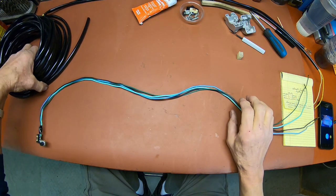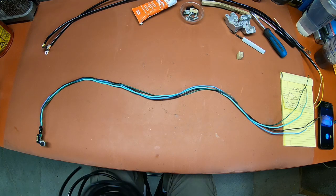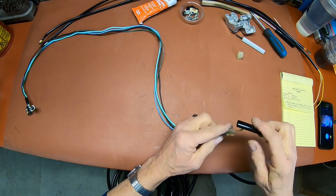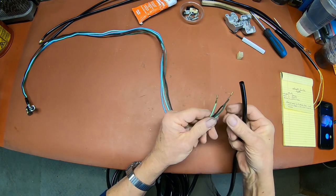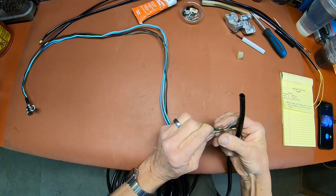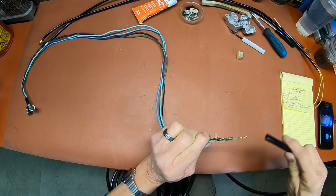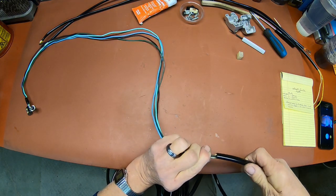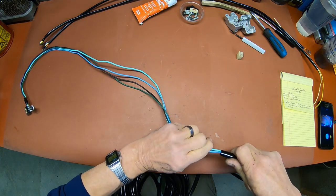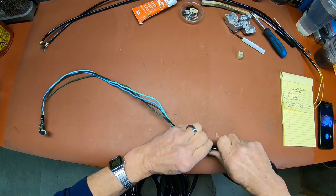All right, I've got my new sleeving here. I believe this is the 9 millimeter sleeving. That's what we're probably going to need for this. And again, when you try to push these things through, stagger them so that all these here are not in one place. So just kind of start it like that. And if I start having problems where it doesn't want to go, then I'll get the Ruglide and put it in there. Just keep little short pushes on your cables.